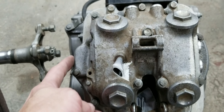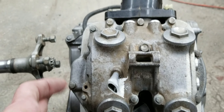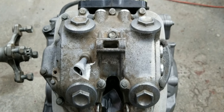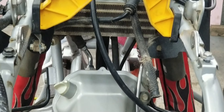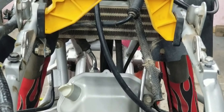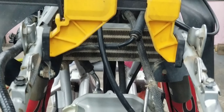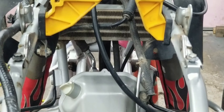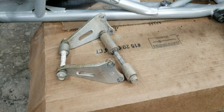It was rubbing right here and right here. What I did was I took the calipers and I measured from here to there and I got 8.166, and in between the frame it was smaller than 8.166, so I opened it up with that clamp and now it's a little bit bigger so it may just give me enough room to get that engine in there without fighting too much.